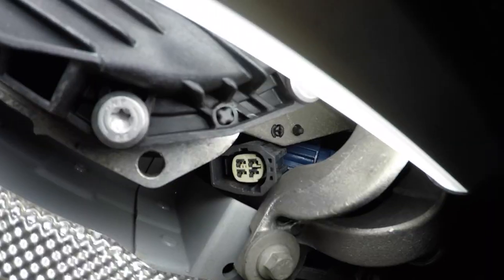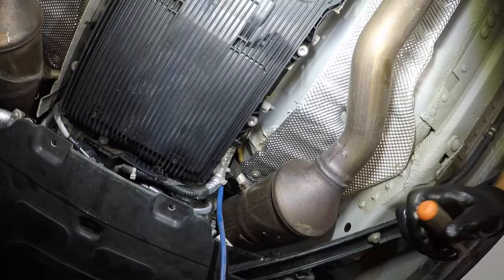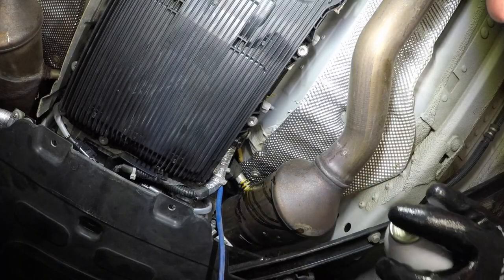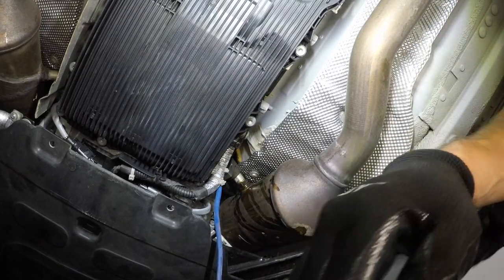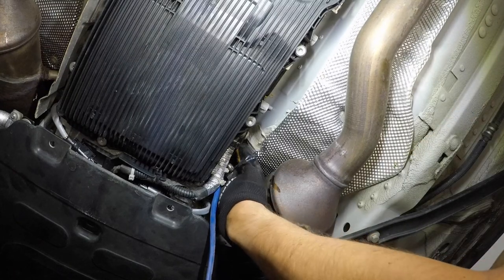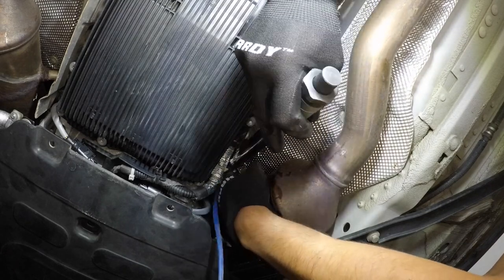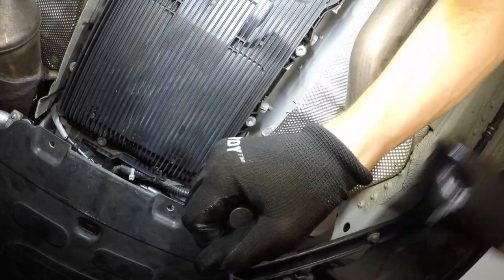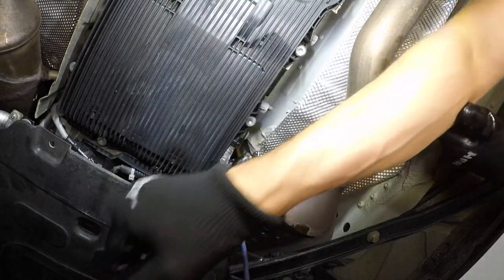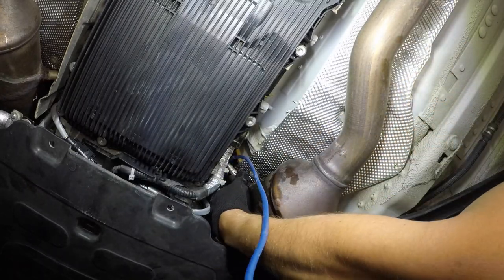This is what it looks like with the wire unplugged and the shield removed. You can see the two clips still hanging on to the wire — definitely keep those. Now it's time to lubricate the existing O2 sensor. These can get stuck on pretty good, so lubricate it and give it five to ten minutes to penetrate. When you come back you'll need a larger driver. Put your 7/8 socket on — the 22 millimeter — and give it a big tug. It'll come free. Once you get it started you can take the large driver off and then just unscrew it.